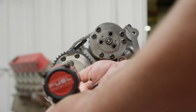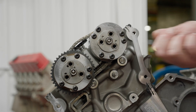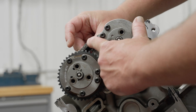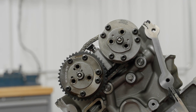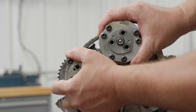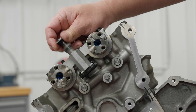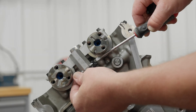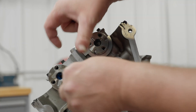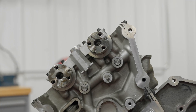Once you have confirmed the cams are at rest, remove the camshaft phaser attachment bolts, then gently start to work the phasers off of the cams. Turn the secondary tensioner's upper contact surfaces clockwise 90 degrees, then slip the phasers and secondary chains off of the camshafts. Place the phasers appropriately so you remember that they were removed from the right-hand bank. You can then remove the secondary tensioner and the secondary chain guide. Next, carefully remove the camshaft phaser oil screens from the camshafts. These will need to be cleaned and reinstalled before reassembly.